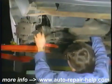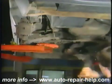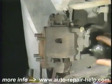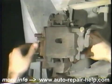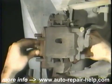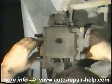Here's a valuable service tip. On some vehicles, the half-shaft assembly can be removed without disassembling the spindle from the control arm, even though the bearing holds the rotor into the spindle. Do not move the vehicle unless you install and tighten a stub shaft, usually the old one, into the spindle and rotor to hold them together. Otherwise, the bearing will surely be damaged even if it doesn't come apart while moving the vehicle.